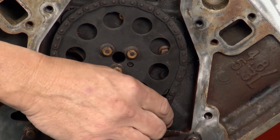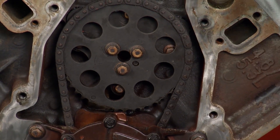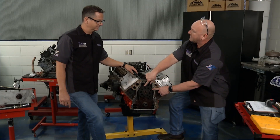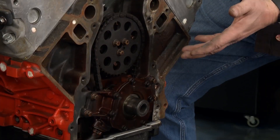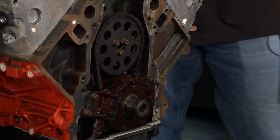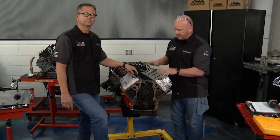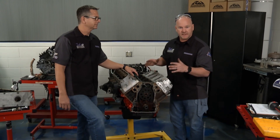Watch this — in that distance of travel, about a half a tooth, if your dial indicator is right there you'd see exactly what that deflection is. We're going to replace all this anyway since we're in here. Another little tip: as you go deeper into this, grab the shop vac and suck all this dirt and contamination out after you've checked for any evidence of degradation.